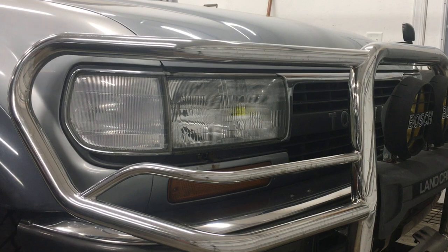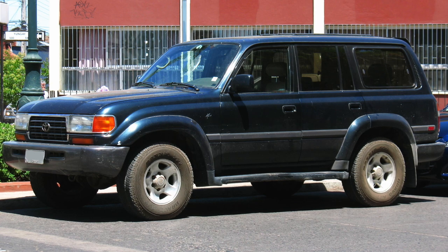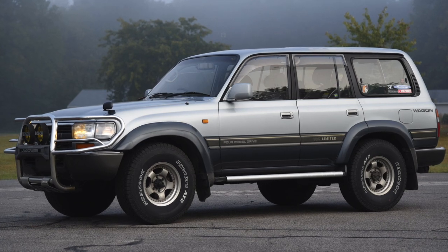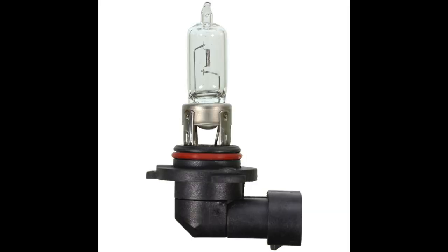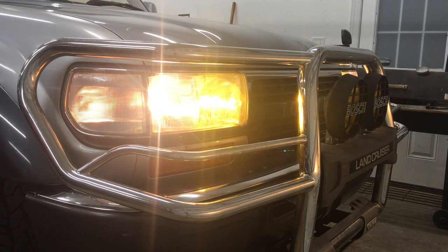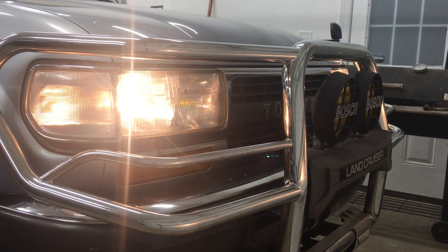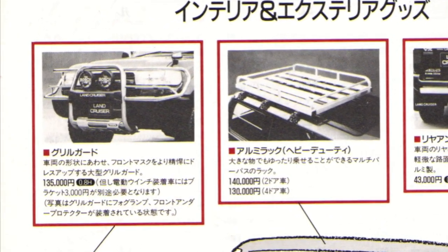Here are the original headlights. They're glass, not plastic, so they won't get cloudy or yellow over time. We need to talk about the difference between US 80 series Land Cruisers and this imported 80 series from Japan. The US models use two separate headlight bulbs for low and high beams — 9006 and 9005 sizes. The Japanese models use one H4 bulb that has the low and high beam in the same bulb. On the other half of the headlight housing, they have an integrated yellow fog light, which looks so good. This JDM 80 also has the rare optional factory Bosch round driving lights on the optional OEM stainless brush guard.